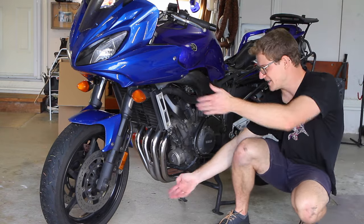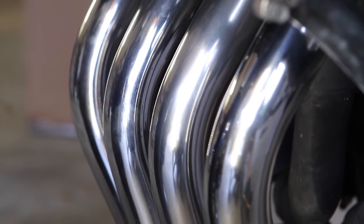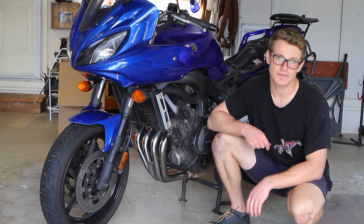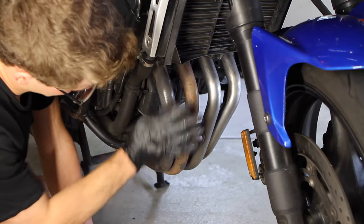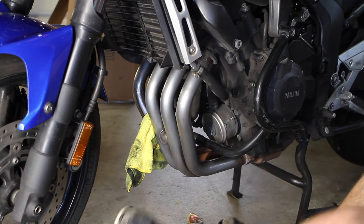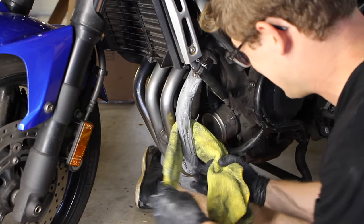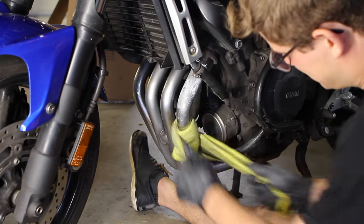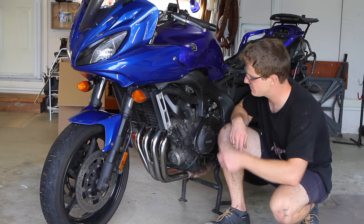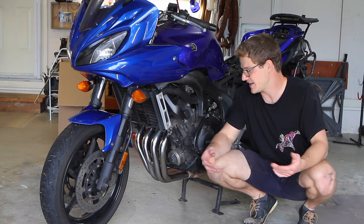And that's a wrap on cleaning the pipes on the 2007 Yamaha FZ6. We got a pretty good surface finish out of this. To start off, I tried using the microfiber but realized that wasn't enough abrasive to get the hard surface rust off, so I switched to a red Scotch-Brite pad and scrubbed up and down the length of the pipe. When done, it left a nice brushed look, but not the high polish I was going for, so I busted out the microfiber again. One trick that really helped was wrapping it around the pipe 360 degrees until I had two ends and could work it back and forth like a seesaw — generating a lot of heat from friction — which gave a nice shiny finish.